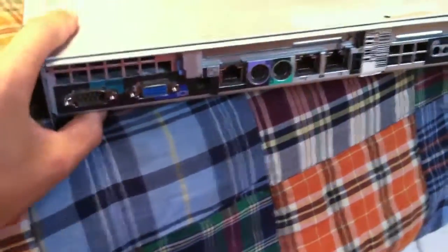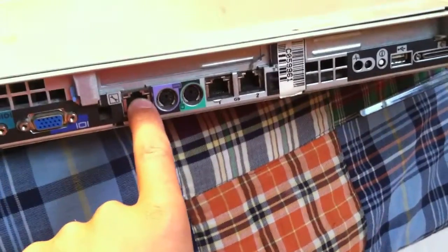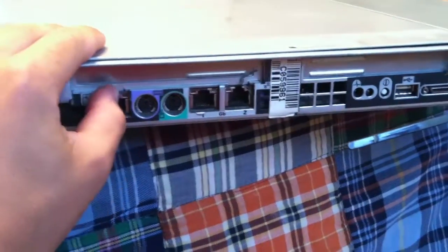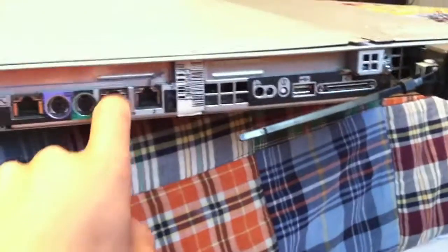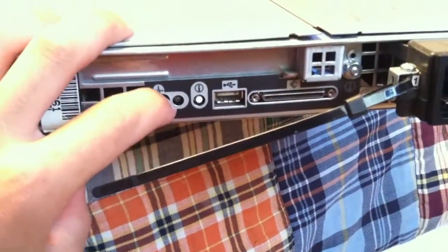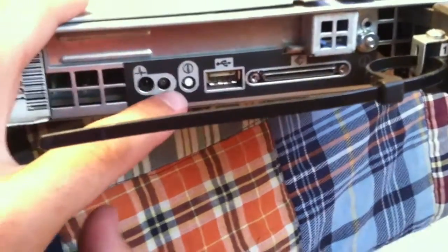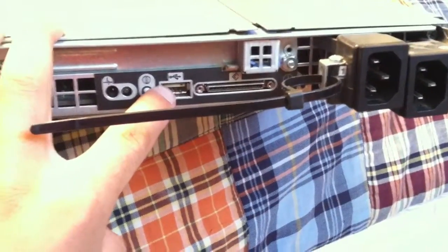Take a peek at the back. The back has a serial port, another VGA. It's got the DRAC access — that's how you can connect to the DRAC, which is actually built on the motherboard, and the actual DRAC card is way up front. PS2 for keyboard and mouse. Gigabit Ethernet, gigabit Ethernet — two of them. There's the indicator button and light again, and there's even a plug so that you can control the light with another external source — no one ever uses that. But that's the indicator light just like on the front. Again, USB 1.1 — there is no USB 2.0 on here.